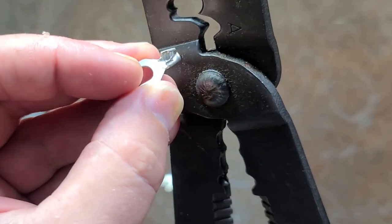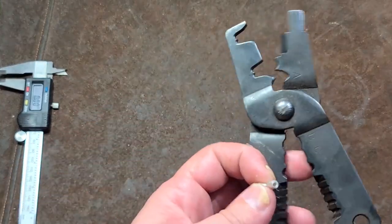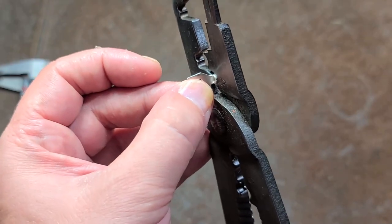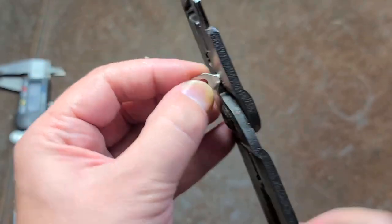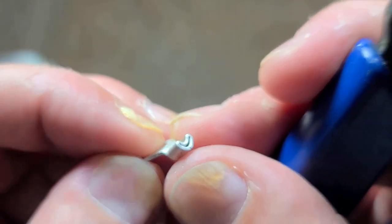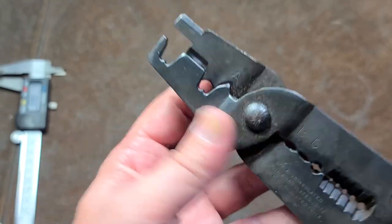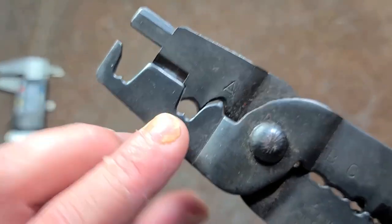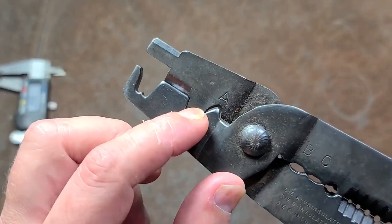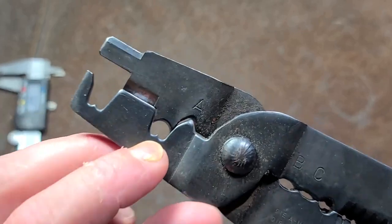You can put it in there - I may have had it in backwards, so we'll do that again with the split facing away from the tooth and do it like that. The tooth gives you a nice indentation in the back - it's actually a pretty nice crimp. Being really close to the pivot, it crimps really nicely. This is for seven and eight millimeter spark plug wire, and you get these special terminals - the wings go around the spark plug wire.